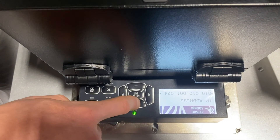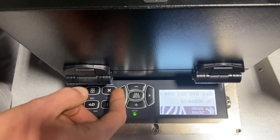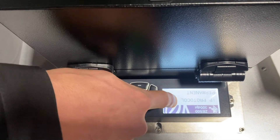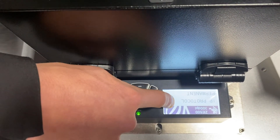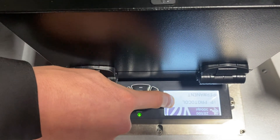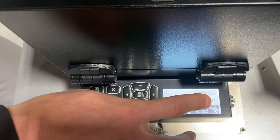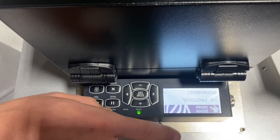I can hit the plus button and change it the same way I just entered the password, going through the entire IP address. If I go to the left to another setting, we've got IP protocol. If we want to give this printer a specific IP address and we want it to keep that same IP address, we must have this on permanent. If it's on DHCP or all, it's going to auto-populate an IP address your network gives it. So we just want to make sure that we have it on permanent if we want to give it one and forget about it.